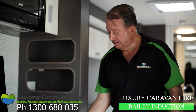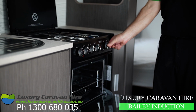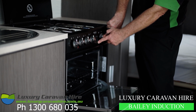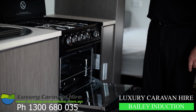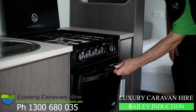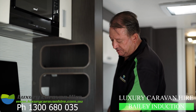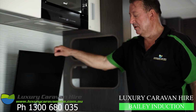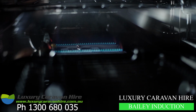If you wish to operate it as an oven, we'll turn the gas knob to off, then over to oven, press and hold again, igniter, keep holding for 2 seconds, let go, your oven's now alight. So we can just operate that as a regular oven now. Well, now that we're done with that, let's switch it off so we're safe. Got everything in the off position. Now we can close it up ready for travel. Gas stove featuring gas oven.